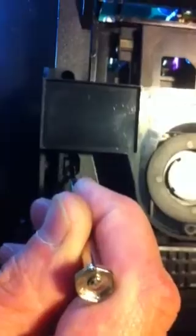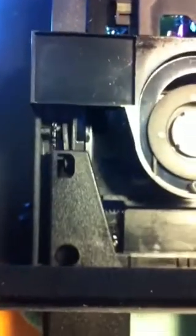This is a bendy tab here, and that will bend to the left or right. Actually, you bend the tab to the right — towards the centre of the drive — and then that will release the drawer. You can see that allows you into the mechanism.